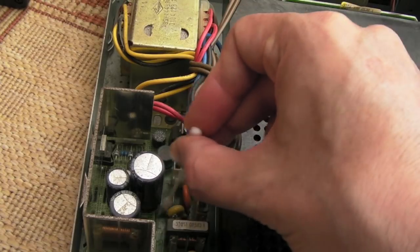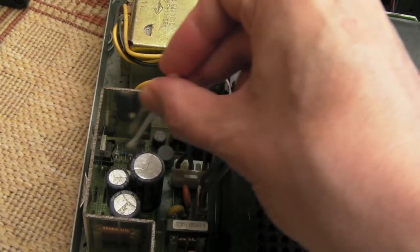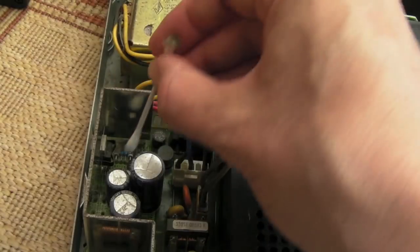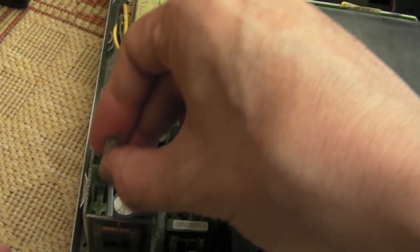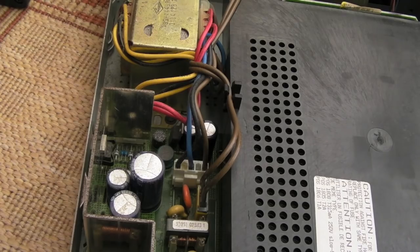This is not a full teardown in this video. In the next video we'll perhaps get the power supply out and check some of the caps, but to be fair, the caps look really good in this. It looks like it's got really nice high quality caps, and they're in excellent condition. But we will want to take that power supply out and have a look at the boards, check for dry joints, check for any leakage or corrosion. But in the first instance, we could just get all the fluff out like this.